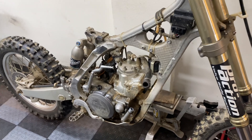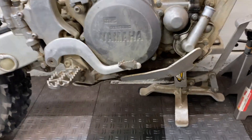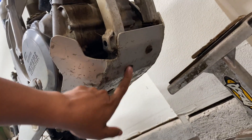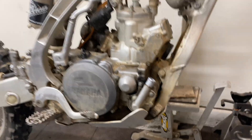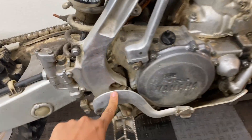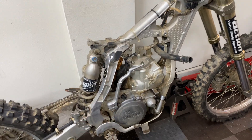What's going on guys, welcome back to Pad Outdoors. This is going to be day two of Project YZE — YZ250 electric dirt bike conversion. Today we're going to wrap up the teardown. I'm going to be taking out the two-stroke engine, the skid plate, and any remaining components and wiring we won't need for the QS138 kit. Since this is an older bike — a 2006 — I'm going to hit all the hardware with some PB Blast. Hopefully that'll make it easier to break loose. I might have to cut off some of the hardware for the skid plate since it's pretty banged up. The last thing I'm going to take off is the through bolt that goes through the swing arm. I'll save that for when I get the bike on a stand a little later.